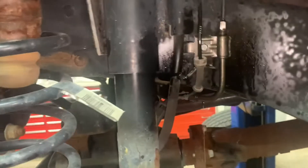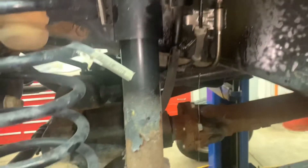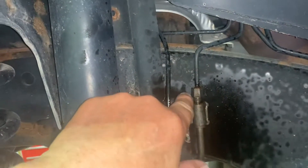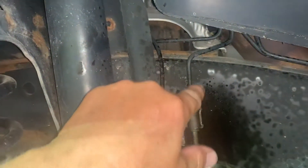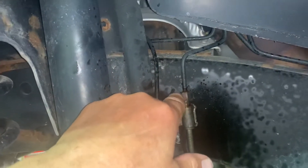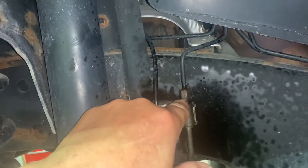You've got that bad brake line with a restriction in it. What you need to do is loosen up your line right here on the fitting. If your fitting turns with the line, or the line turns with the fitting, you need to heat it up with a propane torch or map gas.